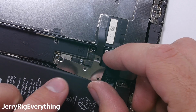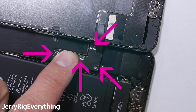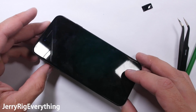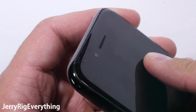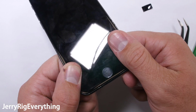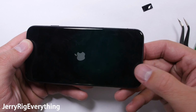Plug the new battery in and then plop your metal plate into place, getting these 4 little tri-point screws back in. Then gently lift up your screen and gently tuck the top of the screen into the metal frame of the phone before gently pressing down the sides and clicking it into place. I said gently 3 times, just barely. Press too hard and you might crack your screen, so go easy on your phone. It's had a rough day.